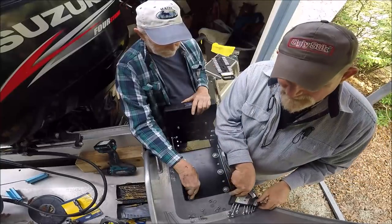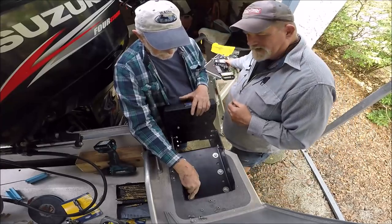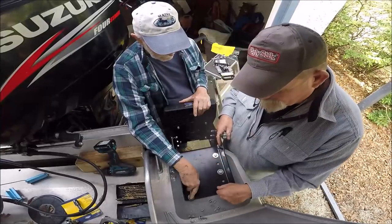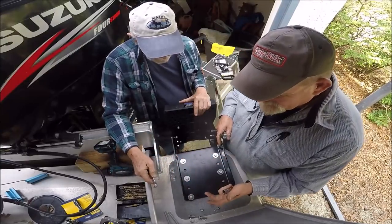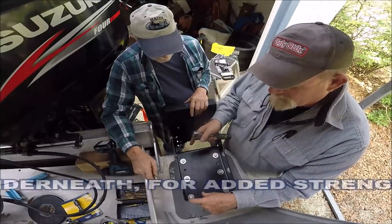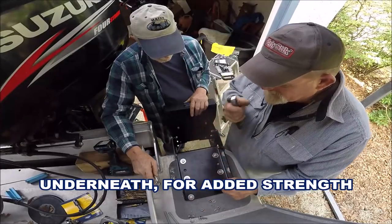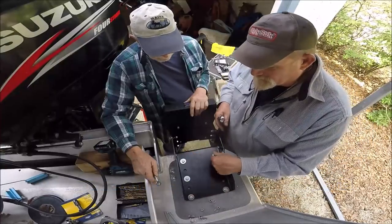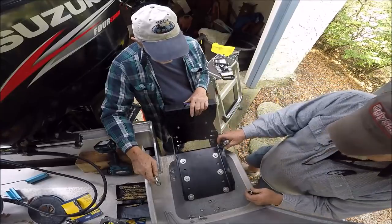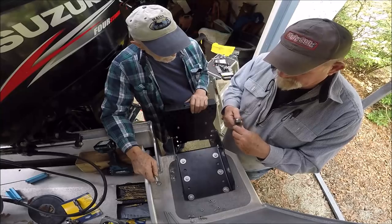Okay, I think we're actually bolting this bracket on. And what we ended up doing is not having washers. I wanted washers on top, so I put a piece of aluminum bar stock as a washer going down for all three of these. And they only said about using minimum, use 4 bolts. Well, I'm using 6.